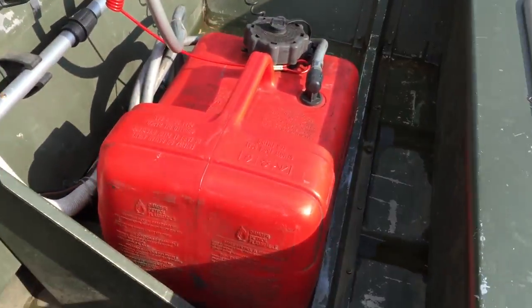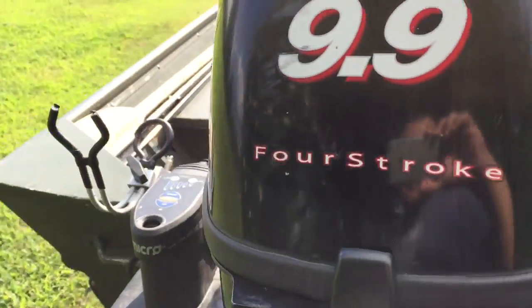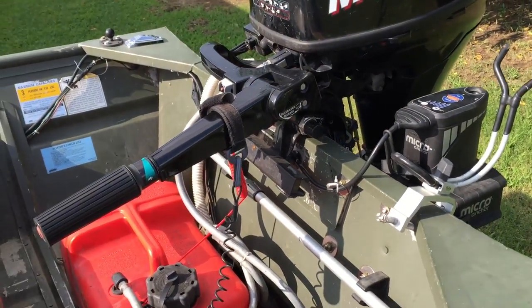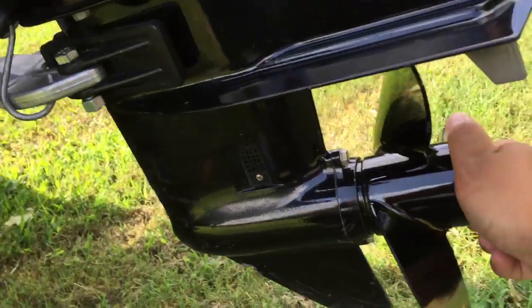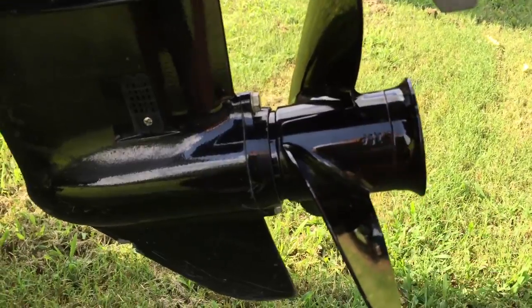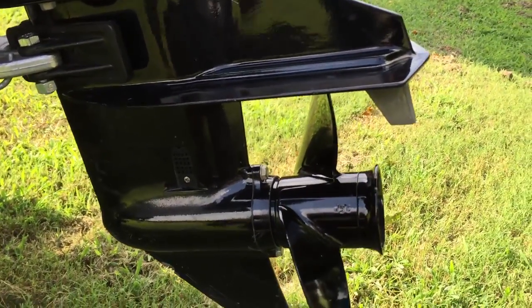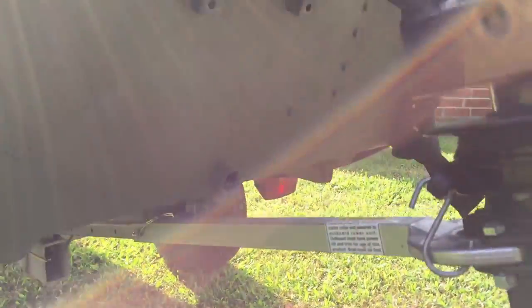There's a one-inch RAM ball mount for extra camera stuff I'll be working on later, and a nav light in the back that did not come with the boat. What did come with the boat was the three-gallon gas tank and the Mercury 9.9 — a four-stroke, 2011 model. With the upgraded prop — a slightly wider, higher-pitch OEM prop, about a 9.5 x 9-inch pitch — this boat will do 20 mph with one person. Two people, you're probably at 17 mph. Three people, you're looking at around 8 mph given the boat's design.